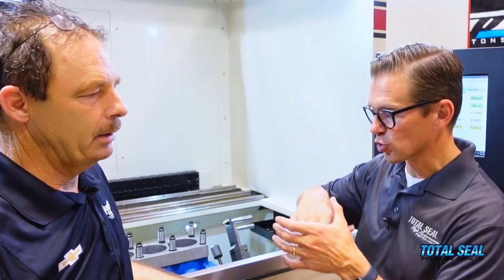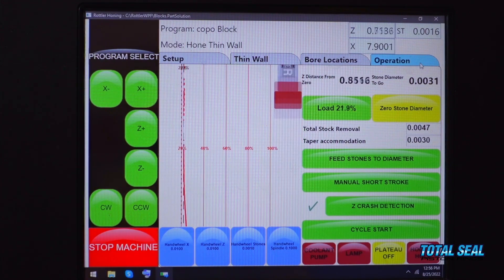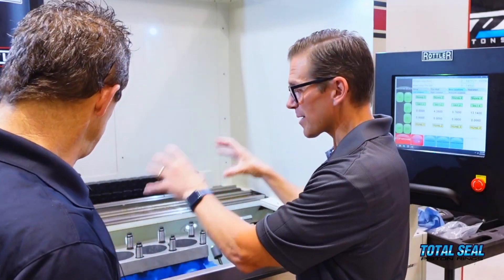That's really step three: instead of progressive stepping, you go to size with the roughing abrasive, then it's not stock removal — it's counting the number of strokes in plateau mode to create that extreme plateau. In the old days a 320 grit abrasive to size, then finish with 400, worked because molly-based rings were porous and held oil. But today's rings have a very hard coating — a very flat surface with nowhere to hold oil — so you have to hold it in the bore.